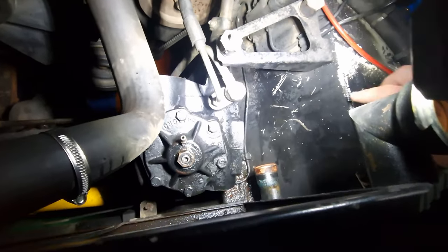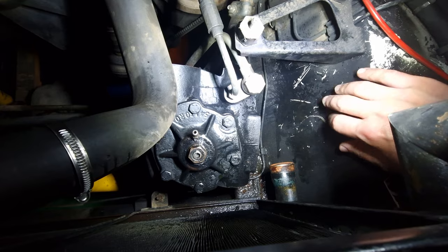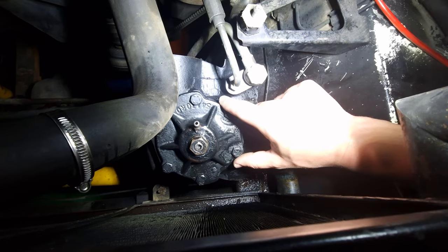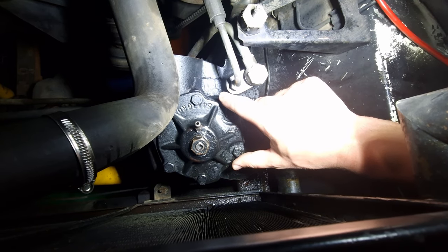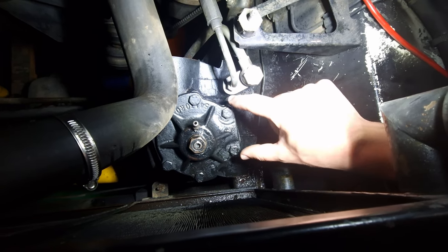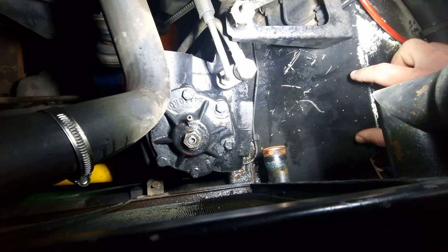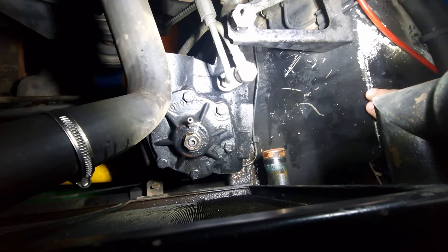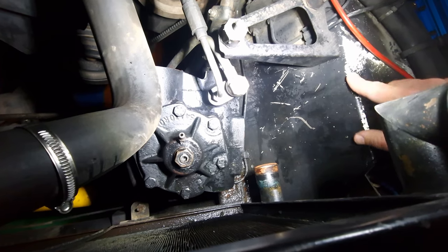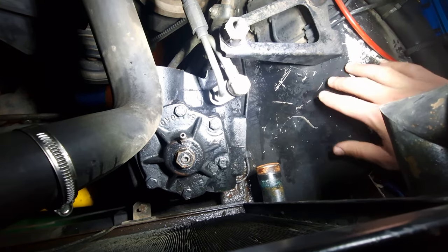So what I'm going to do is, I can't come from down here from the support because it's no use. I have to support this top part to the chassis, okay? So what I'm designing is a support that will get these two screws. I think it's going to be sufficient, just these two. I don't think I have to come all the way to these as well. And it will have a thick steel plate to here, okay? And then I'll tighten it onto this part right here, where it's folded, okay? The strong point right here. And just tighten it right here. Like that will give me strength, and this will not move.